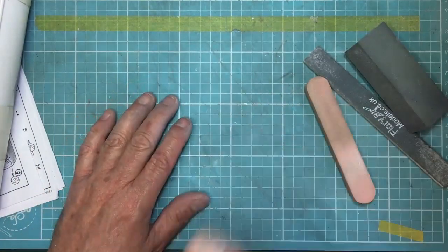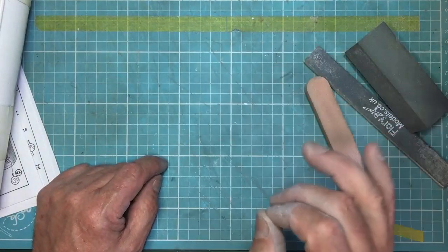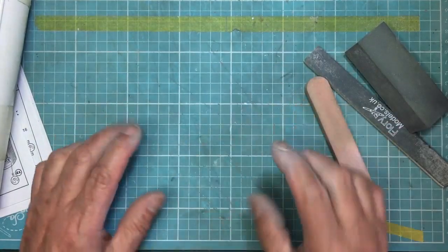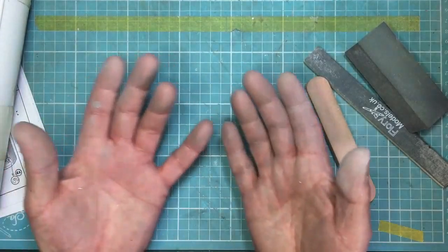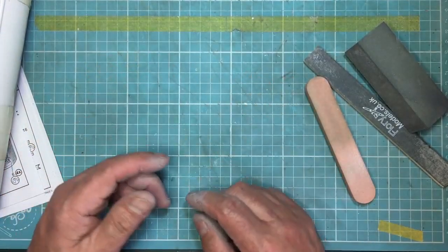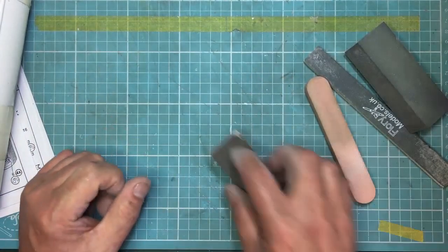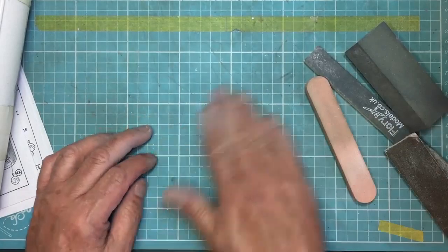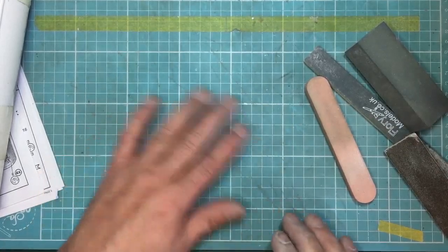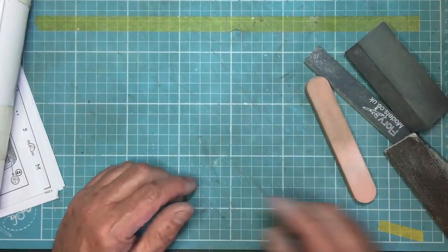So, which is why if ever you want to sand away, like if you do a stone chip on your car, put a drop of paint in there, let it go off, put another drop in there until it's slightly raised, and then get some 2000 wet and dry, worn out the better, on a little block of wood or a little block of metal, and just very, very gently rub away until you see the lump disappear. And then when you polish it with some T-cut, a rubbing compound, whatever, you haven't sanded away the paintwork around the outside of it.